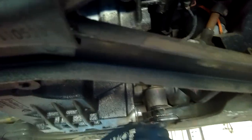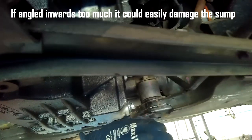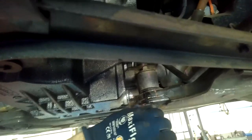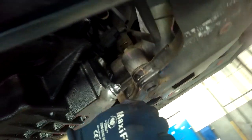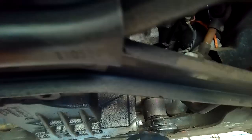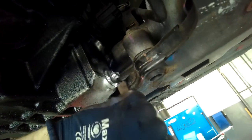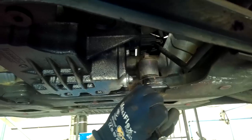Essentially what I did was get my chisel, aimed it outwards away from the sump so it wouldn't bear on the sump — we're trying to protect it so no damage happens there. I'm trying to create a groove so while I'm shocking into the edge, I'm also trying to get a groove deep enough that I can angle and hit it hard. I'm hitting it quite lightly until I create a channel within the sump plug head. Once I have that, I can start to impact it a lot harder. If you just have a shallow bit taken out and you impact hard, you can chip that off and have to start all over again. So you want to get deep enough within the head that the groove holds when you hit it hard — so it actually turns rather than just breaks off.